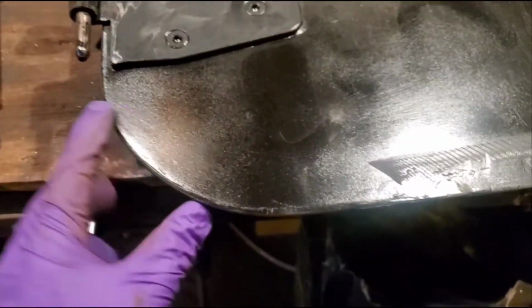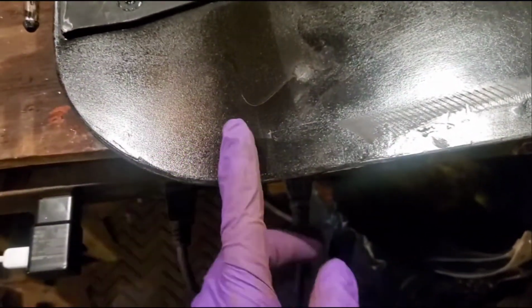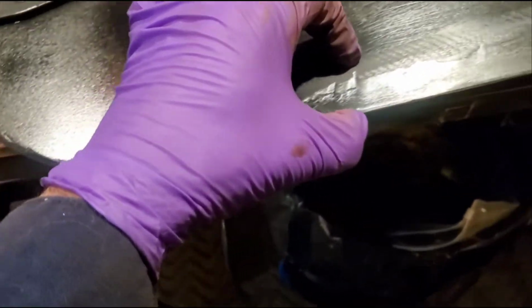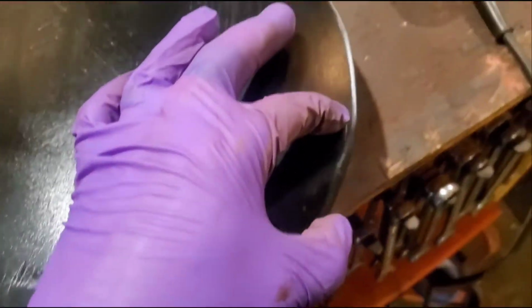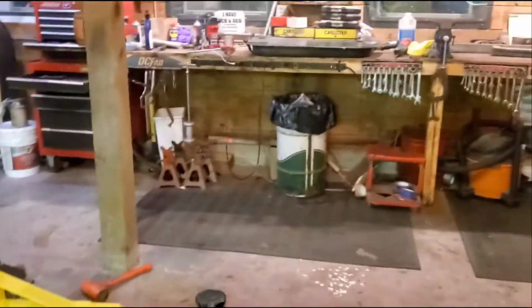So what I'm thinking I'm going to do is, it's fine from this bend. I'm not going to mess with this bend. Not that it's hard, I just don't need to touch it. So I'll just cut here, do about an inch and a half strip, take it out, and I gotta come up here because there's a rust spot. And keep going. So I'll start cutting that door, and I'll just show you how I do it.